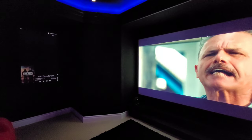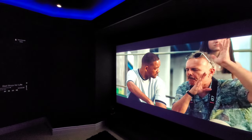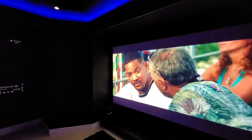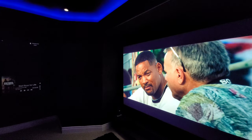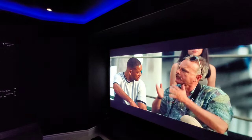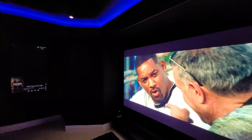I'm sitting nine feet away from this screen, approaching the sweet spot of 4K where your eyes can resolve the detail. And I'll be perfectly honest — with this native 4K versus an upconverting 4K, especially the UHD65, it was such a minor difference in detail that I wouldn't even consider it a game changer. Look at the specs from a holistic perspective. In a dedicated theater space, you've got to give credence to contrast ratio, and JVC is a leader in a league of its own when it comes to contrast ratio. That was the biggest difference for me, along with the way it handles HDR.